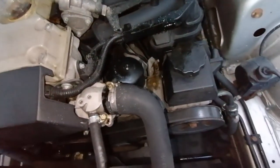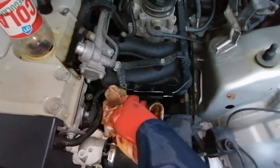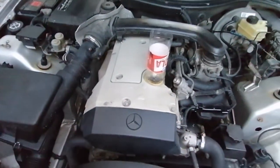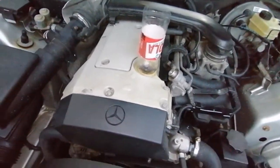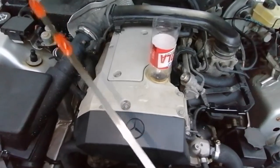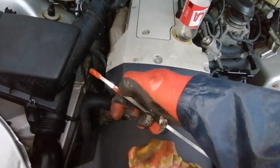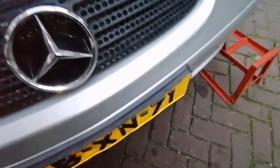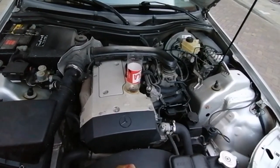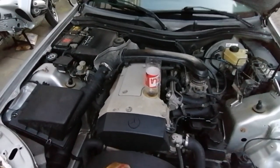The oil filter is nice and snug. I made a little bit of a mess so let's clean all this up and give it a good wipe down before we finalize everything. I didn't have a funnel so I made an improvised one from a bottle — just cut off the top, make sure it's clean so no debris gets in. I've removed my dipstick. We'll fill it up to the correct level — halfway or a bit less since the oil is cold and will expand. This engine takes five and a half liters. If you like this video give it a thumbs up and subscribe to the channel!